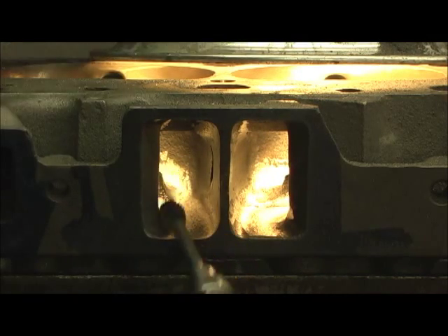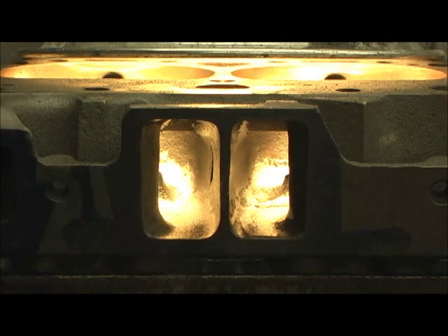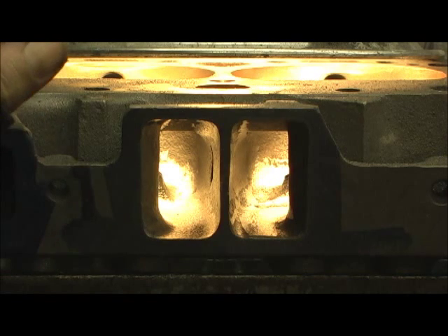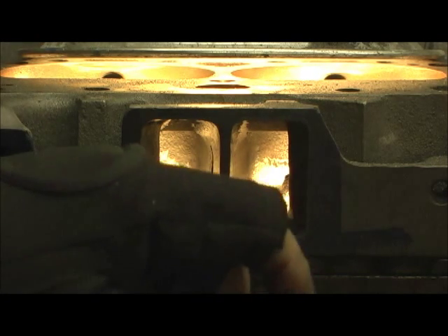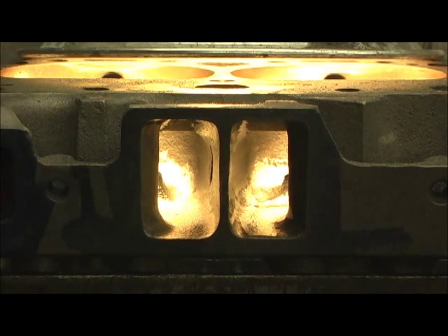I also had to go in here and move this wall over some — that wall has to come over. On the math side, right here I'm looking for a 1.050 to 1.080 window max — 1.080 is the absolute max. Start pushing any more and you're probably going to bust through the pushrod. Also, one way you can tell that one of these heads is where it's supposed to be on the roof line — I'll give you a hint on that.